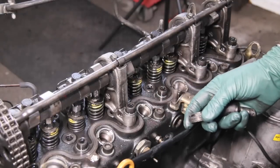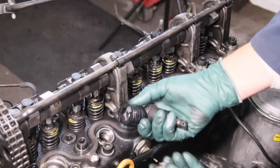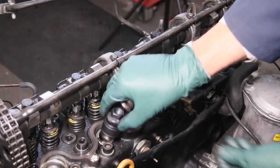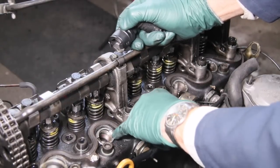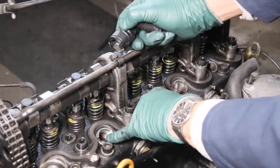We've developed a special tool here in our shop. This is made out of hardened steel. It will go in and get in those notches so that you can remove this collar nut without damaging it. Because if you try to use any other kind of tool, you're going to break off the corners right here.